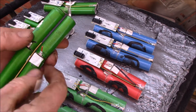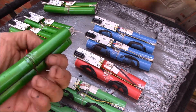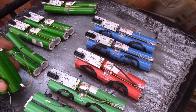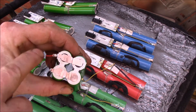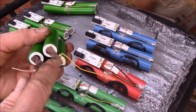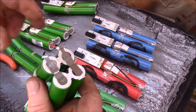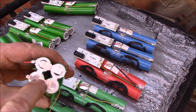I just like to get rid of as much of the tape as I can, any extra insulation. You get the tape off and there's usually a piece or two on the side. Folding these together, you get the cells opened up like this, so you have two parallel connections on this end — your plus and minus — and then on the other end there's two series connections.